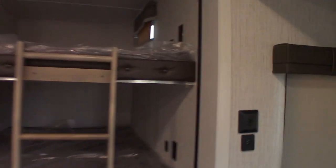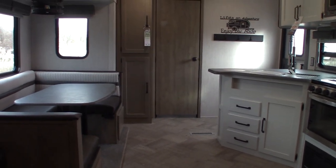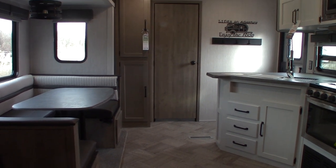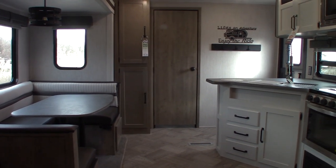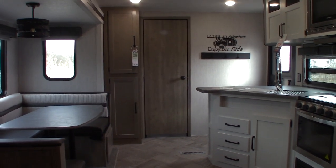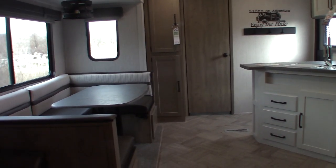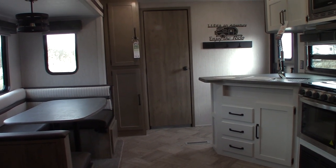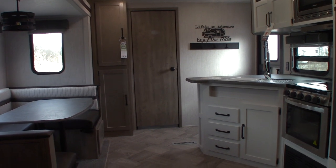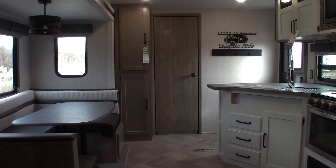Thank you for purchasing your trailer here at National RV Detroit. Please remember what I said about inspecting the roof every 60 days — that's a manufacturer requirement, so you want to keep after that to protect your investment. It's part of general maintenance: keep an eye on your roof seals and make sure there's no damage from low branches. Right now this is winterized — all the water's been purged from the system and replaced with antifreeze, the water heater is bypassed and empty. Once you get ready for camping season, make sure you put water in the water heater tank before you turn it on. Thank you.